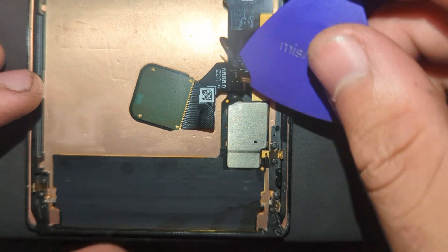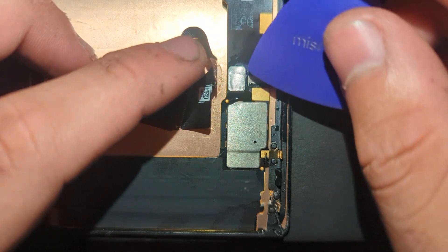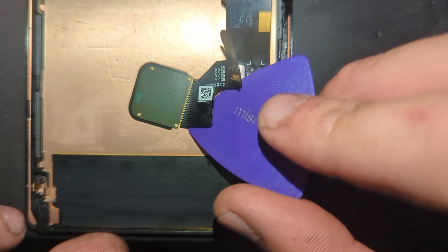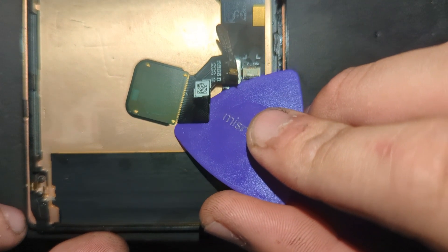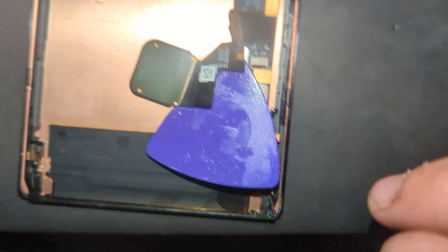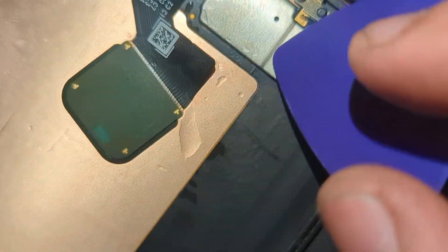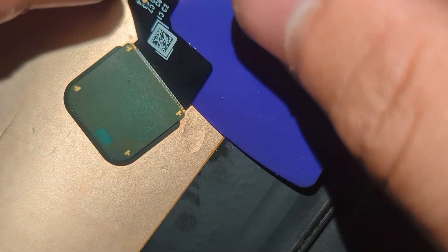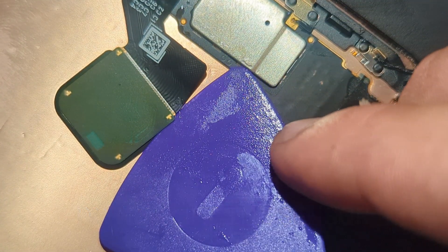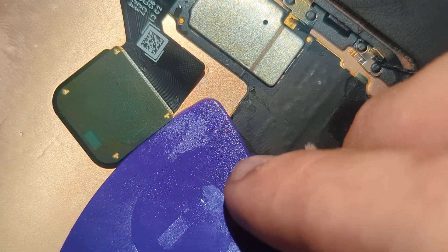You will feel when it's free. Don't worry about the alcohol — if it's isopropyl there is no issue. I'm at this point right now and I will try to get in there without damaging the fingerprint sensor. I poured some more alcohol in because it's at the peak now. The trick is not to lift the fingerprint sensor because if you lift it you will damage it.